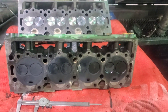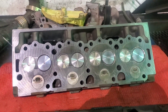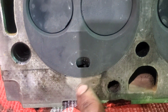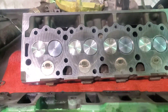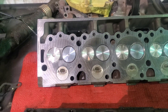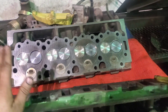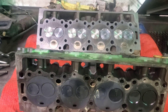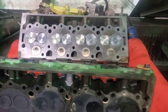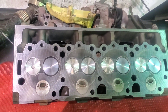They might even be the ones I port for the new motor. But on to the new ones - look at them! These ones do have the double square pre-chambers with the T on them. My old heads just had the single square, the smaller NA pre-chambers. These are just the factory early turbo ones, not the diamond ones. With all the guys I've talked to, we seem to think these are actually the better pre-chamber because they are more matched to the combustion swirl area on top of the piston itself. I'm going to give those a whirl - maybe the next engine I will try the diamonds and do some comparisons, but on these heads I'm going to run the double square pre-chambers.